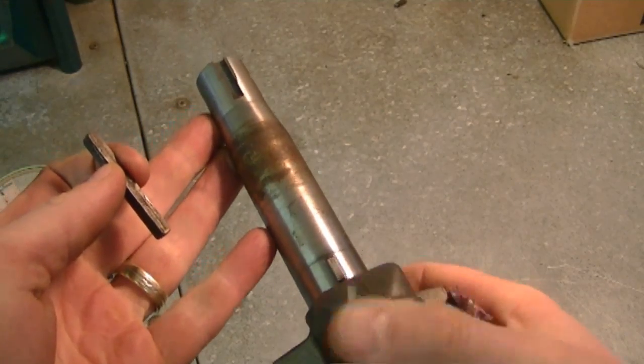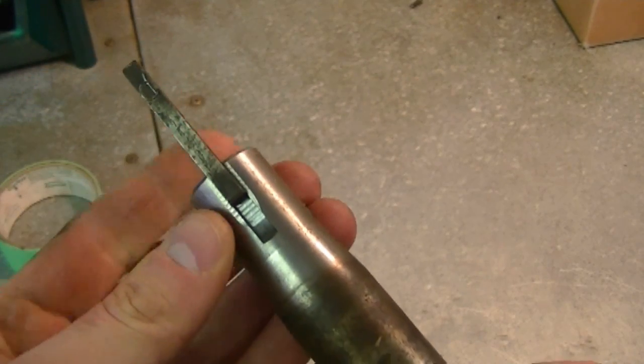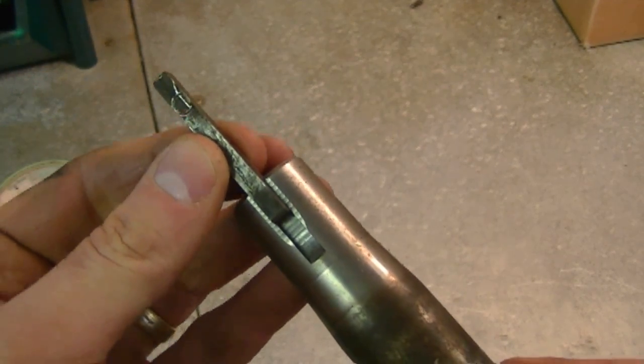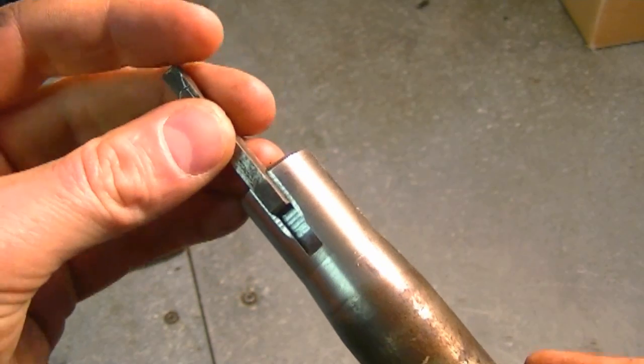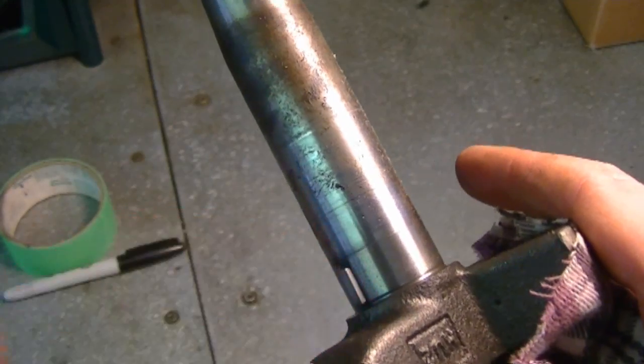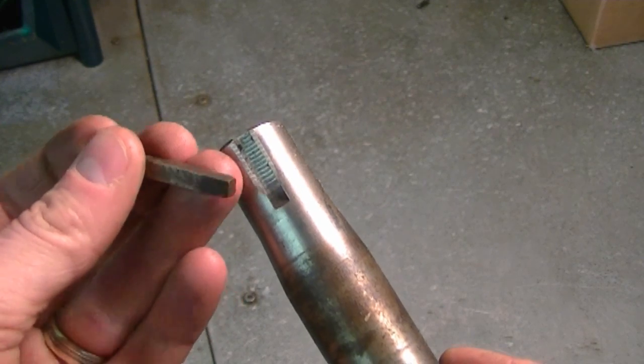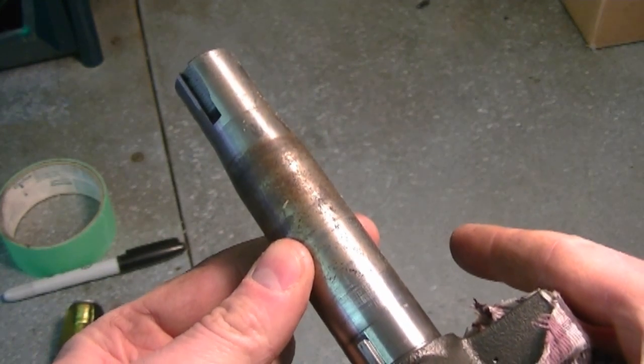Another YouTuber asked if all keyways come off crankshafts. Well, 99% of the time they do. Here's a crankshaft in my hands — you can see the hole for the keyway and here's the keyway that goes in there tight. This isn't the actual keyway for this engine but I'm showing it as an example. You can get them off using a flat screwdriver or a chisel and just punch them out — even a small keyway can be tapped out with a screwdriver and hammer. You'll need to do this especially if you're replacing the engine crankshaft seals because they need room to get out.